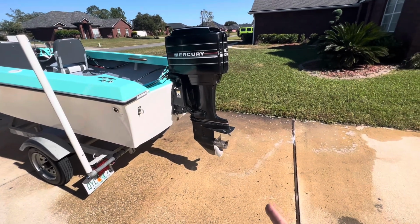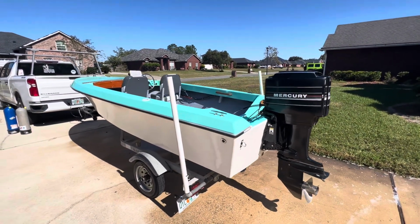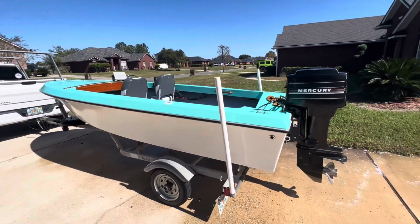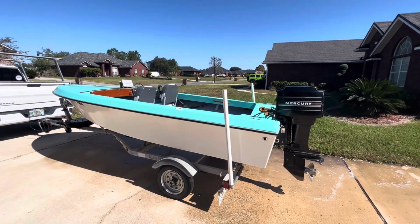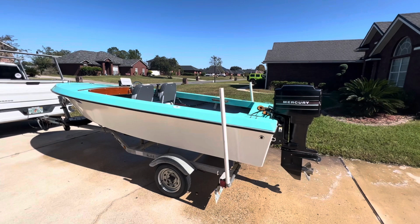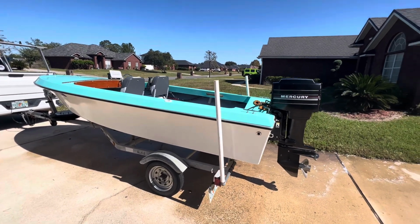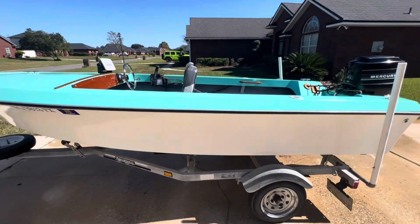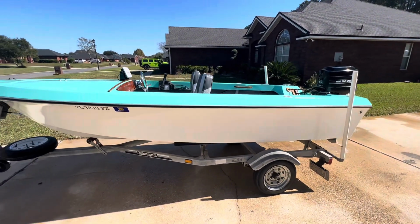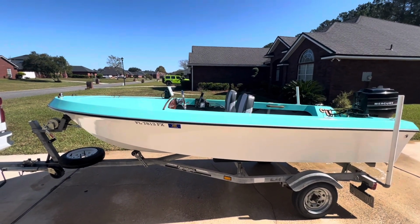This is a stainless steel prop that I already had, but since I plan on towing some people with it, with the tubes and everything, I think having the prop just a little bit under pitched is good. I've got no tach, but I've been a long time Mercury guy, so I can hear when a Mercury's at 5,500 and whatnot, so I'm really not worried about over revving it. It doesn't over rev as is right now, but I know it could probably turn 1 more pitch higher. But that is it. Work on getting the windshield on there, and that will really kind of set it off.